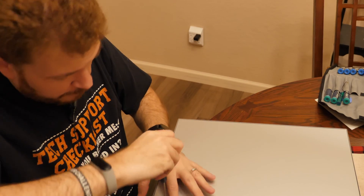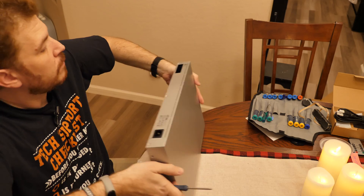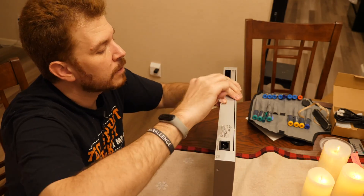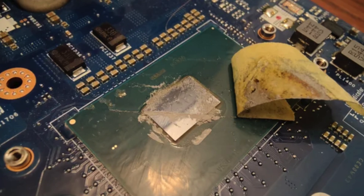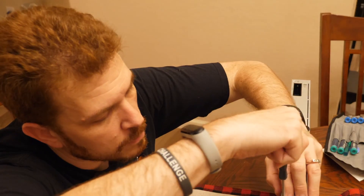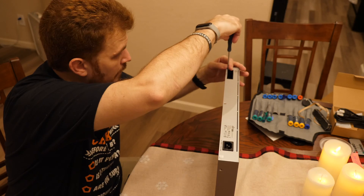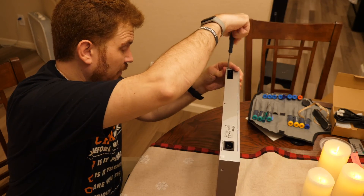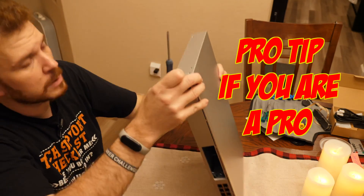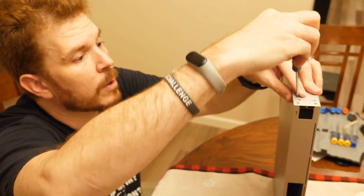This was a pre-COVID laptop — so what's your excuse, Dell? I'm calling you out. You've ignored me on Twitter and when I call support I just get the runaround. I did fix it by carefully removing the tape, cleaning with isopropyl alcohol, removing the dried thermal paste, and reassembling — it never overheated again. The takeaway: if you're competent at disassembly and reassembly, it might be worth inspecting new gear. It just depends on whoever was assembling it at the factory — was it a Monday or a Friday?